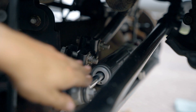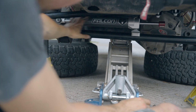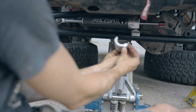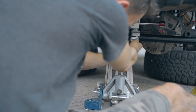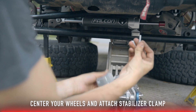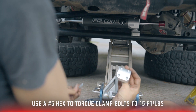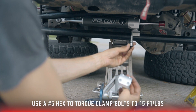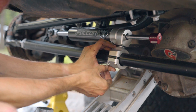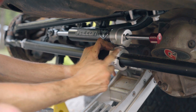We don't want to damage our new stabilizer, so go ahead and do that if you need to. Make sure your steering wheel is centered. We've got our stabilizer on here, centered within the shaft. Now we're going to take the clamp and attach it onto the stabilizer — four bolts, and I'm going to put some Loctite on them; it's always a good idea. These guys are going to get torqued down with a hex number five to 15 foot-pounds. While doing this, you want to make sure you're tightening the clamp evenly so you have an equal gap all the way around.